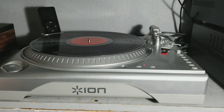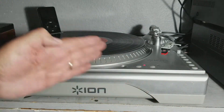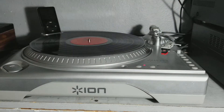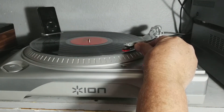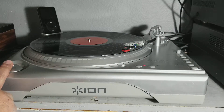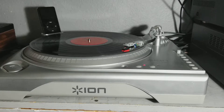So now let's hear what it sounds like. There's another thing you can do with this as well, and I'll show you that in a minute. The back of these units has a pretty nice little feature — you also have anti-skating. So if you notice that your needle seems to lag, bounce back this way or bounce ahead, you would adjust that with this little dial in the back. So lift the clip, pick up your tonearm, set it down on your record, and press the play button. My receiver turned to monitor because it was set for my TV last night.